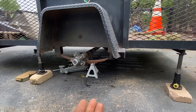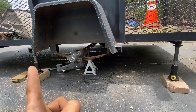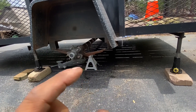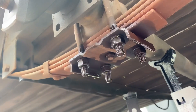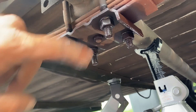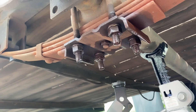You're gonna need to have this set up so the axle has its own jack and jack stand, and so does your trailer, because the trailer frame has to give you a good gap between the axle. After it's jacked up safely and secured, you gotta get these four bolts off. Most of the time they're gonna be rusty and nasty — half the time they're gonna break. Instead of being like me and getting everything off and then having to go back to the store for hardware, just get the hardware when you're there getting the leaf springs.